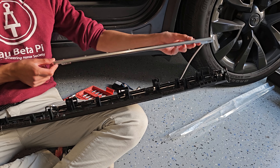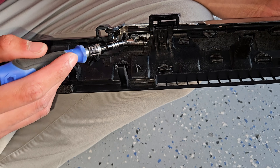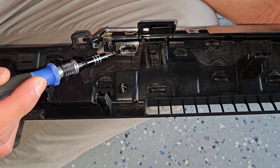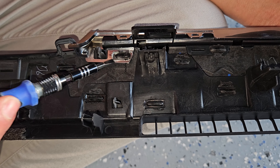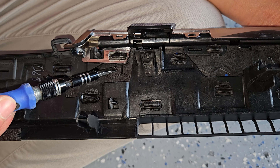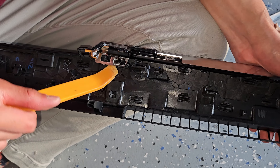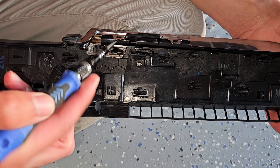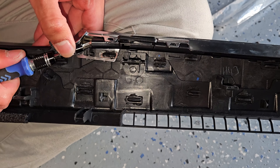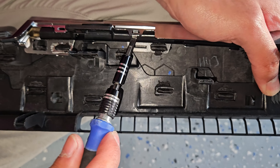You're going to get these replacement pieces from the kit — there'll be one that says Left and one that says Right. The Right one goes on the passenger side, the Left on the driver's side. It has a wire coming out of it, and we're going to take two extension cables down to our receiver in the driver's side footwell. Take a pry tool and break this connection — this black part is just melted plastic joining the silver plastic to the backing. Start wiggling up at it until that connection is broken.